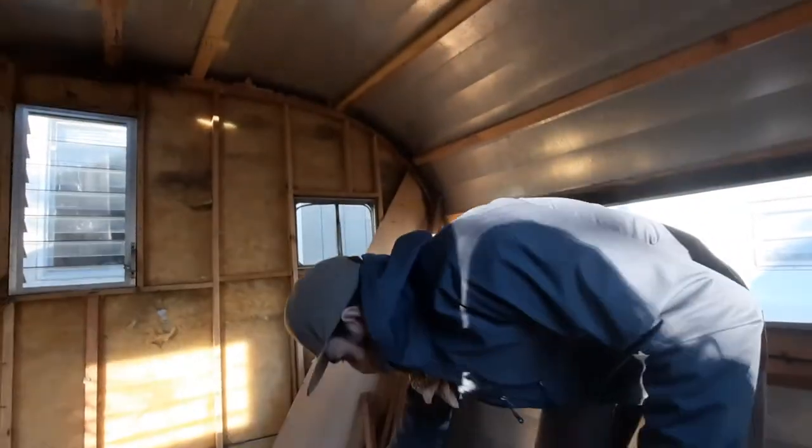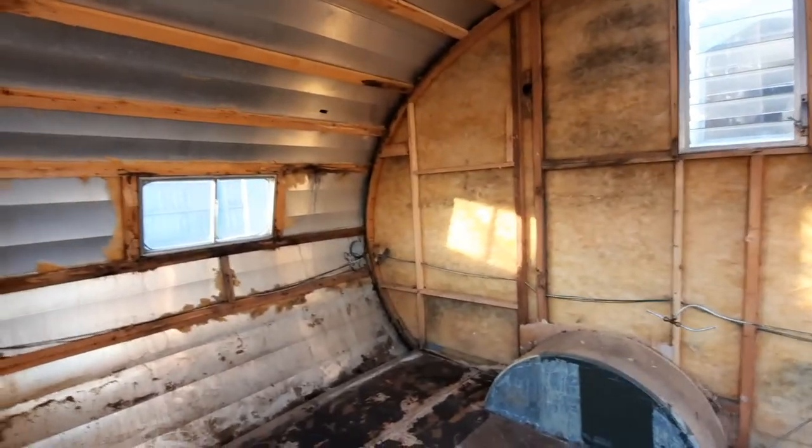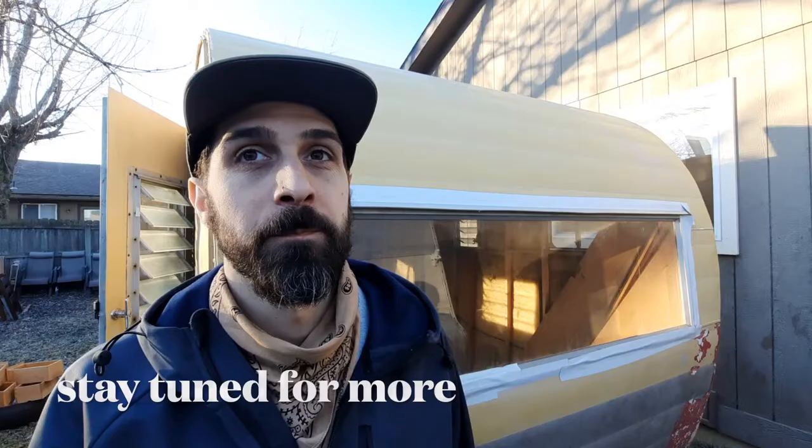It's quite different, huh? A little bit. So I don't have a floor anymore. Yikes! How'd your first day go? Day one pretty good. We still got to rip out the subfloor, and I'll probably end up taking off a little bit of the J-rail in some spots so I can repair some rot damage, but I'll eventually replace all the butyl tape below the J-rail anyway to prevent any future leaks. So yeah, went pretty well.